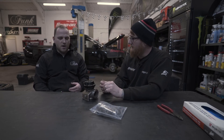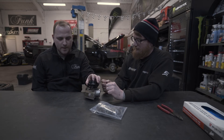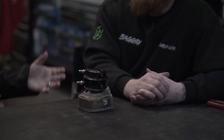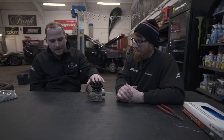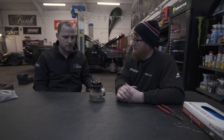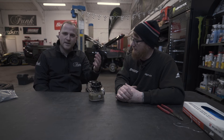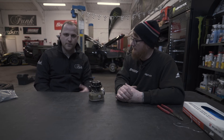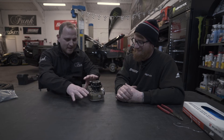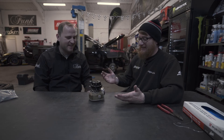You can fit that in your car or off the car — really straightforward, and you're going to get those benefits. A huge thing which a lot of people tend to overthink or don't think about with wastegates is that inside here, there's a very thin diaphragm. That's the whole point of a wastegate blanket — it's slightly different to a turbo blanket where you're stopping heat radiating. In here there is a diaphragm which, after heating and cooling repeatedly, can start to produce boost leaks because the seal isn't quite as good. By putting a wastegate blanket there, you're going to stop that heat radiating from the wastegate into the diaphragm and reduce wear over time. You'll get more consistent performance, more durability — not just from the wastegate, but the coolant pipes, boost pipes, everything. Performance, protection, reliability — that's the key. Keep your stuff under temps and keep it working for a long time.